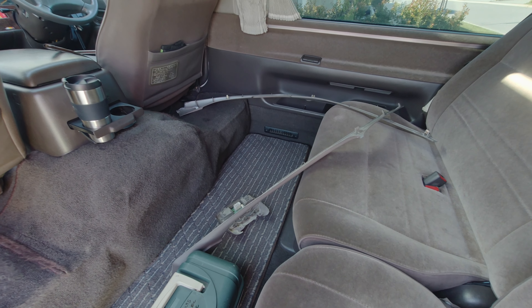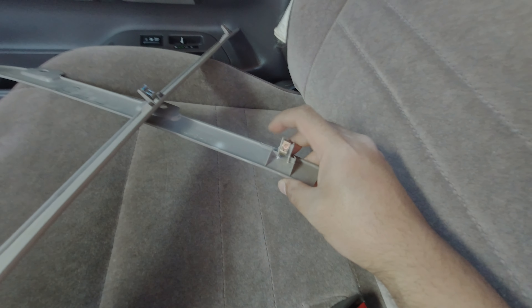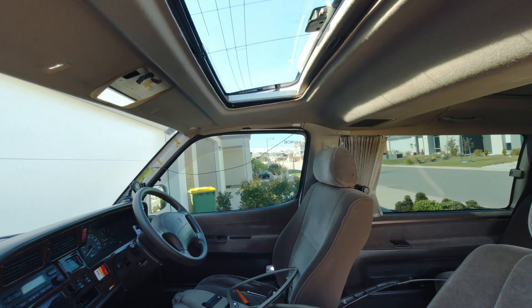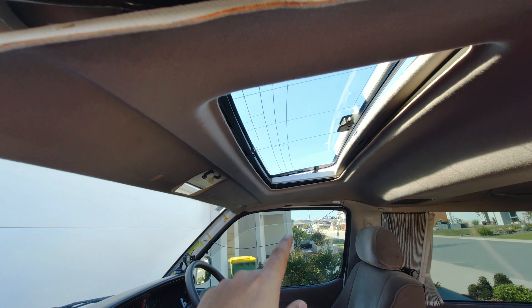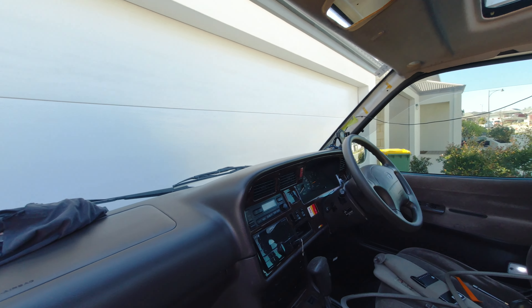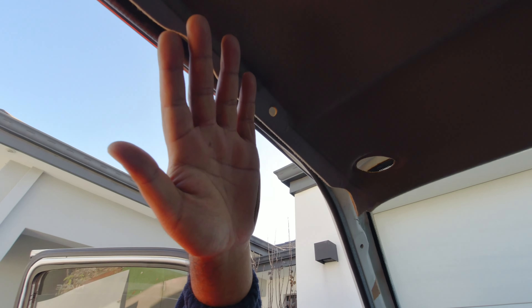That's fixed! Honestly it only took about half an hour. The trim panels came off alright. The only issue I had was on the passenger side — one trim clip is broken, but nothing a bit of double-sided tape or superglue won't fix. For the sunroof, surprisingly you get pretty good access. You take off the grab handles up here, both on the passenger and driver's side, using just Phillips head screws. Then you take off the trim panels on both A-pillars — they pop off all the way up and then pull up and slide out.